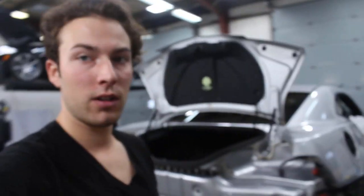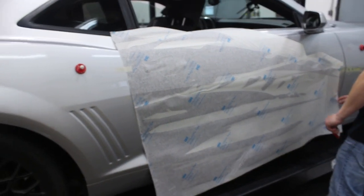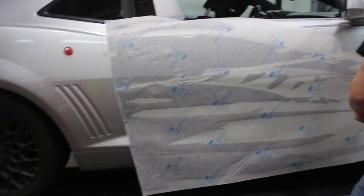I had to take the seat belts off there. And then there's screws underneath the airbag there. There's those screws there for the coat hangers, some pop-out ones. Now I have to take this whole piece here off, and then the headliner should come easily off. Chris is working on the other side here, so that's just mirroring the other side, just on the passenger. It's freaking pouring outside. It's been monsooning for the last couple of days.